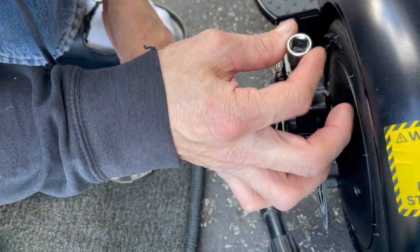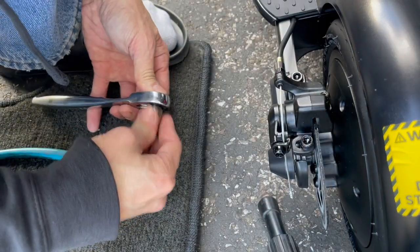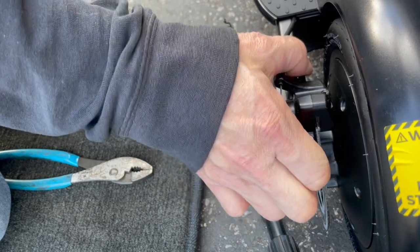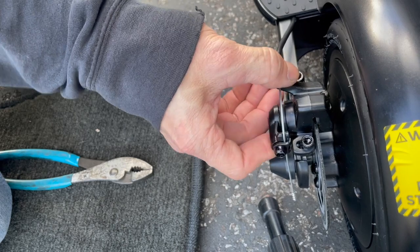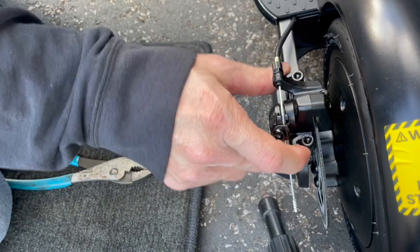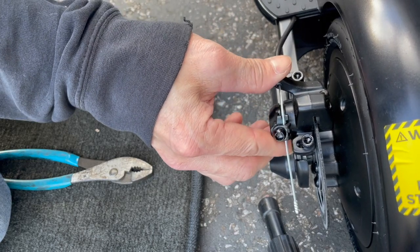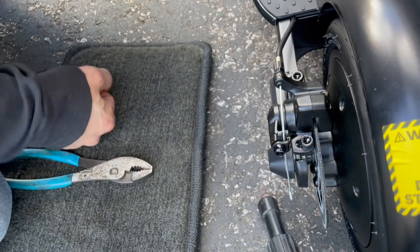So I'm turning this — it slightly, really lightly stops. That's what I want. I don't want it to be sloppy, otherwise there's more to adjust. What you do is you squeeze the brakes, and when you do that it kind of centers itself — the brakes center itself a little bit, without deflecting the rotor.